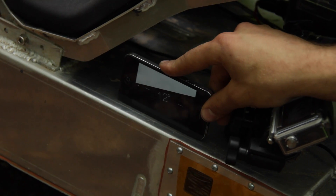Alright, so we just finished the low range testing starting from a complete stop on a hill. This hill behind us was 12 degrees where we started. First, I did the test purely under electric power, and then the second time around we did it with electric and pedal power combined. Under both tests, it was able to start from a stop on a 12-degree hill. It increased up to about 15 degrees, and at that point we started getting a lot of wheel spin because we were starting from low speed.